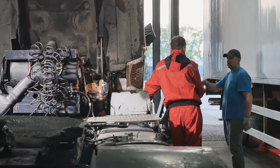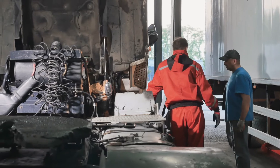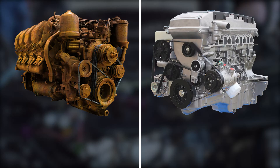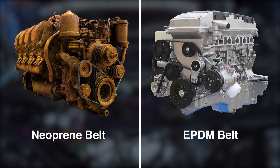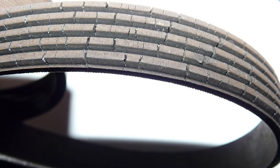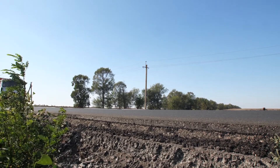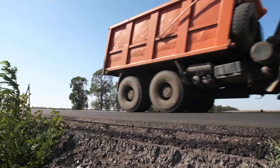The first line of action is inspecting a belt for wear, and you can no longer rely on your eyes to tell the whole story. Today's EPDM belts wear differently than their predecessors. With a neoprene belt, it was pretty easy to tell by the belt's appearance when it needed to be changed, but with EPDM belts it's more difficult. That's because they tend to wear the same way as tire tread — the rib profile gradually gets worn down and changes over time.